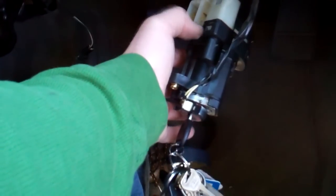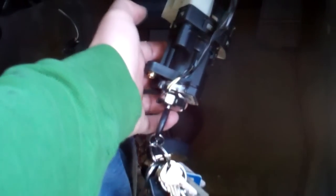You also have the park safety cable — there's a little tab right there that you just push down and pull out, and then there's this little one here that goes into that little slot there. One word of note when putting this park safety cable in: leave the key in the on position, because there's a cam in here that moves, and if you have it in off, the park cable can't push into the slot because it's trying to keep the key from turning. So leave it in the on position, or keep the lock cylinder out until you're ready to put this in — that's a tip that might not be apparent for most people.